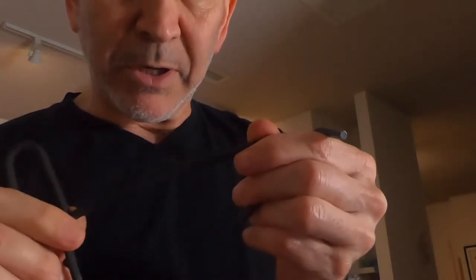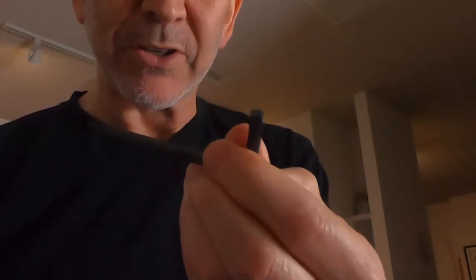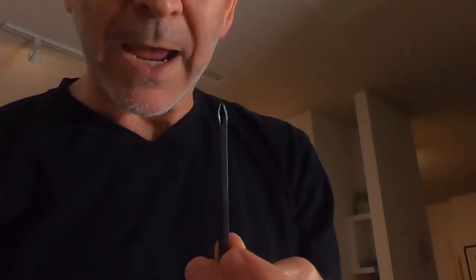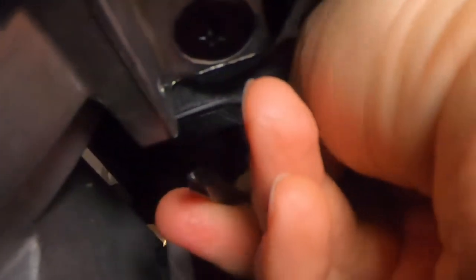Okay, I have a correction to make. This is 4.75 millimeters, and that was the wrong tool for the job, but they give you this, and this is 5 millimeters, and it has the correct size of Phillips head to undo those small screws for the fabric of the dust system. So this is the tool you need. I will just get the tool in there and turn.